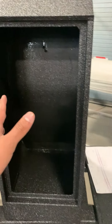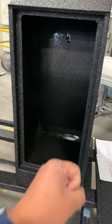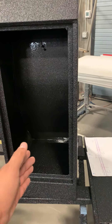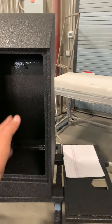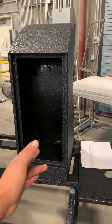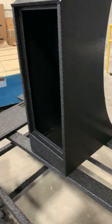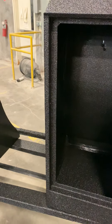Now when this sits on the trailer, the door always opens out — so the door will open this way. Those holes are for the hinge. So that means when I'm facing directly at the trailer, this is gonna sit on the curbside and that's gonna sit on the driver's side. And right here it says left hand, right hand. So this would be the left hand and that would be the right hand. Think about which hand you would use to open the latch, pull it open.